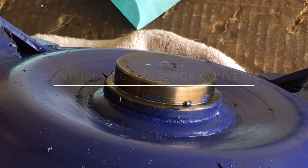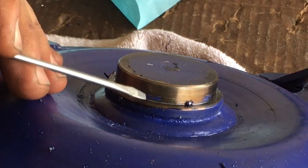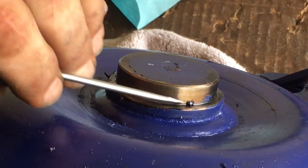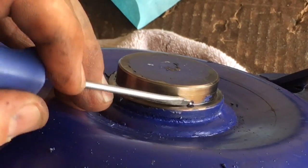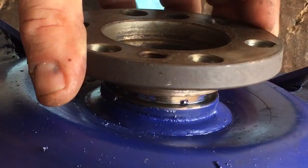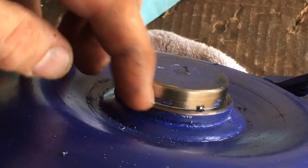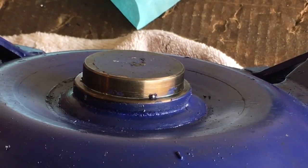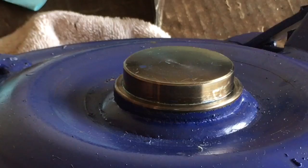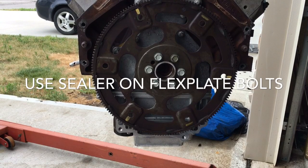Here's a tidbit supporting why I always stress checking everything. While cleaning paint off the register, taking a screwdriver and scratching off the thick rubberized paint, I found welding slag that somebody hadn't noticed on the torque converter. That metal would interfere with the converter's ability to slide onto the adapter — it would hit that piece of slag before reaching the machined surface. I removed it. It was definitely interfering with engagement to the adapter and the crankshaft.